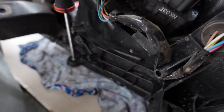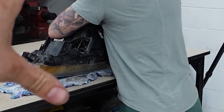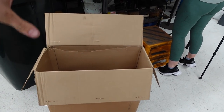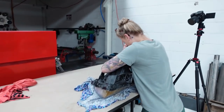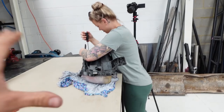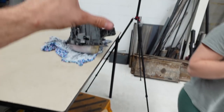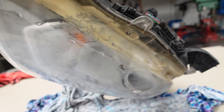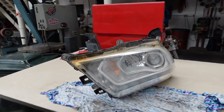I've decided to step away from the tools and let the professional take over. Ames is stepping in with her Phillips head screwdriver to undo the five Phillips head screws holding the lens onto the headlight assembly. Then what we have to do — and this is at your own risk — is use a box as a kind of oven. I put the headlight into the box and then put a heat gun in from the outside facing in. If you have an oven at home that you can use and it's big enough, do that — it will be so much easier. Just make sure you have it on a very low setting. The goal is to heat up the inside of the box and the headlight so we can remove the lens from the headlight assembly, because it has adhesive all the way around the outside.